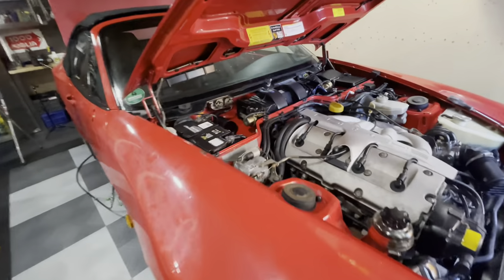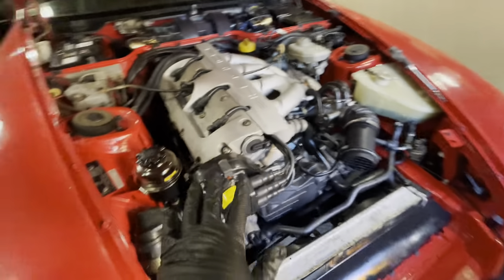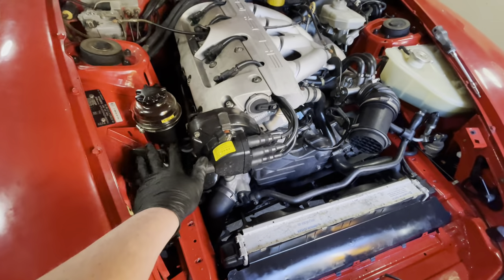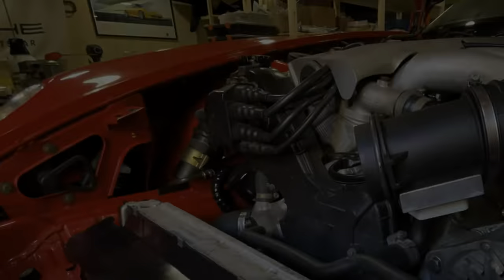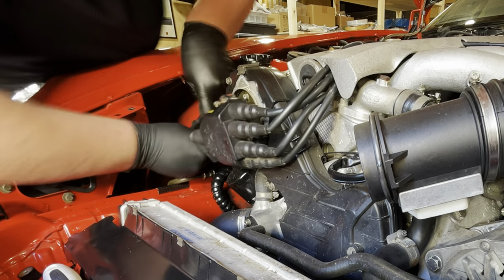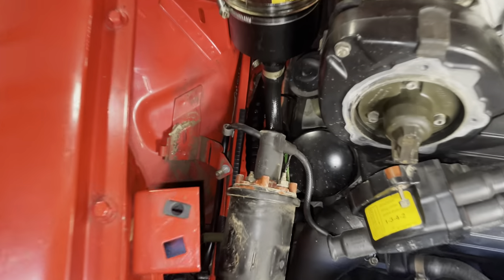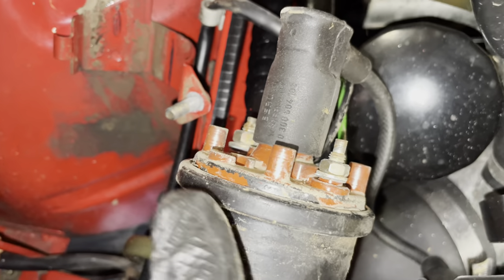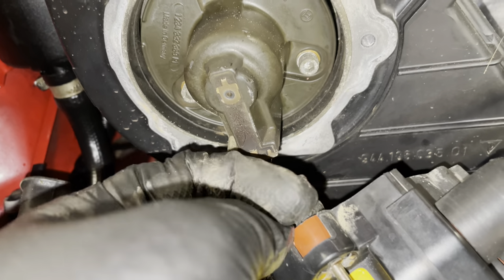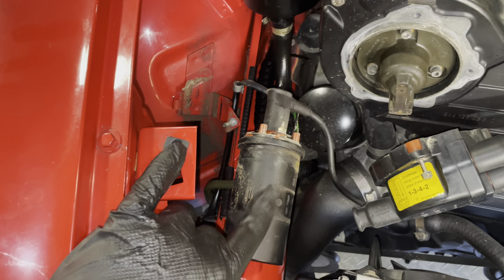With the car on the lift, the first thing we want to do is disconnect the battery, as we won't be needing that for a while. Then I'm going to take off the distributor, disconnect it from the coil, and remove the covers. I've immediately discovered dirt that needs to be cleaned — on the coil and also inside the distributor. The rotor looks quite worn and feels rough, but luckily I have both of these new. I'll clean the coil and make sure it's ready to go back on as well.